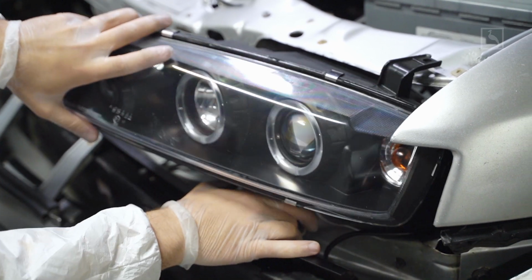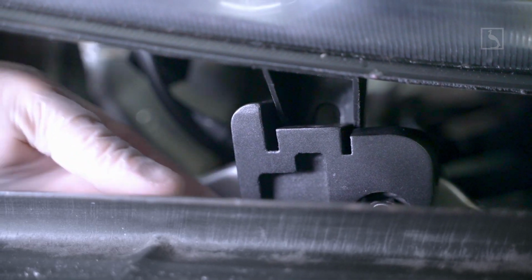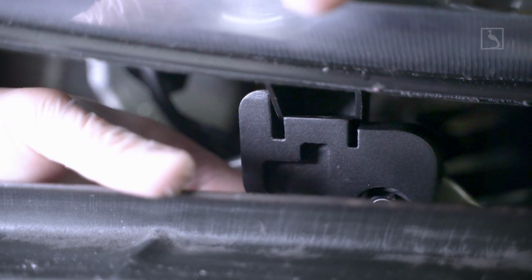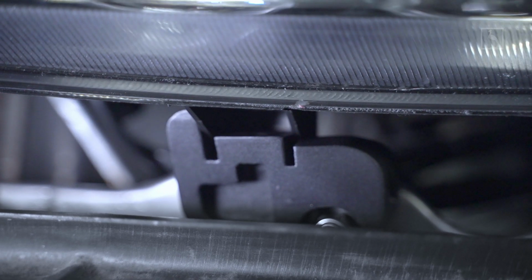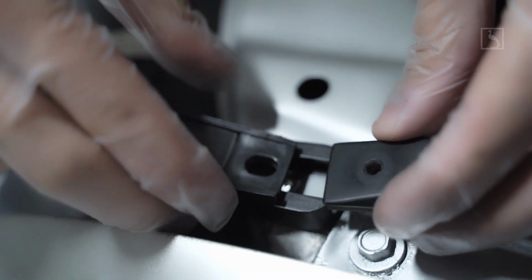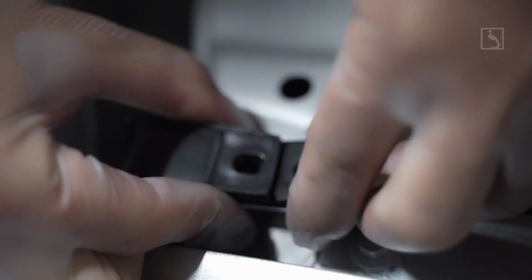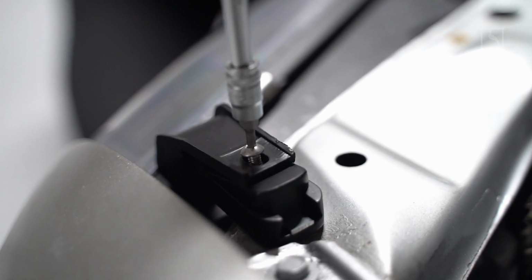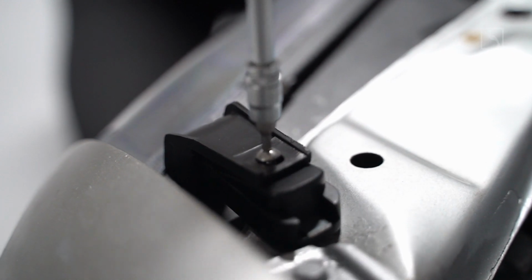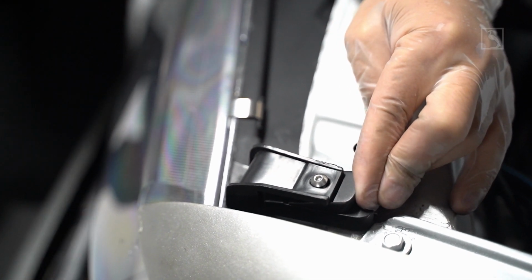By helping with one hand from underneath, clip the bottom tab in the slot. Insert the top sliders and inner top screws of the headlights. Adjust from sliders for correct fender and hood clearance.